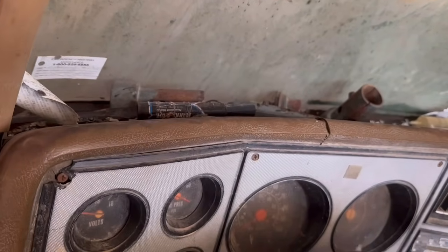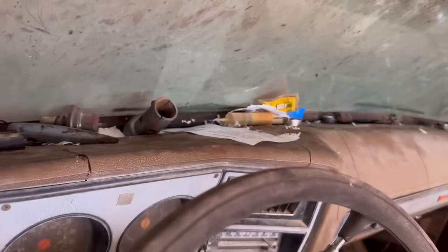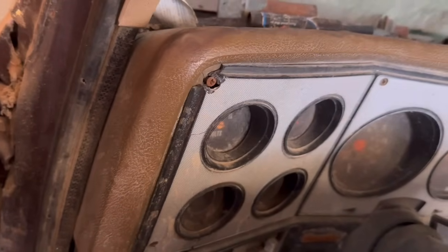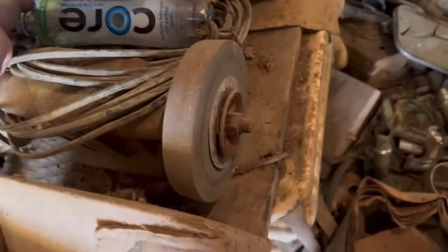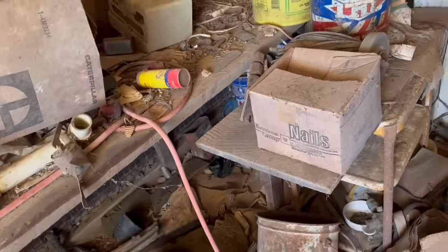All right. Check for power. We've got power. Okay, let's see what happens. Come on. Obviously that ain't right because, you know, I just put 5 gallons of fuel in it. Just to see if we can get it to fire, let me find what I did with that bottle. Here it is. Dump some of this excess gas in here and dump down the carb and then try it again. All right, let's try that again.